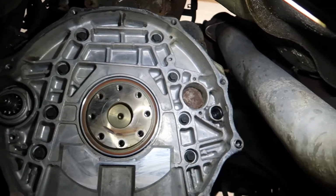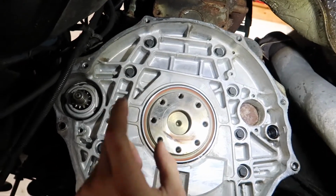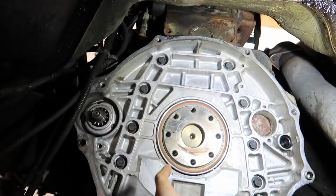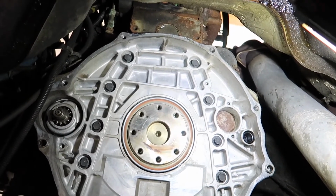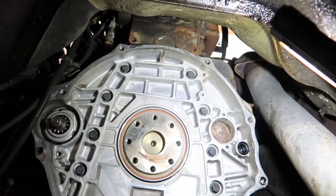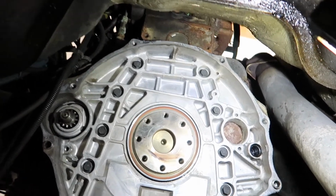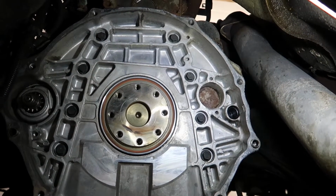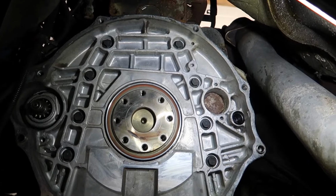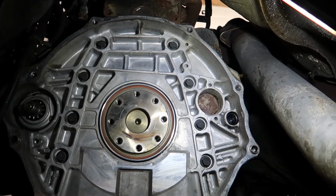Today we're going to be making a video on how to replace the rear main seal on a Cummins. I found lots of videos online of guys doing these, but never in the truck really. Found one on a newer truck, none on these styles and none how I'm doing it. The Mopar guys, the Chrysler mechanics, and even my Felpro instructions say to drill 2 holes in it, and yes, I get that you can scratch your crank. I'm going to be real careful.